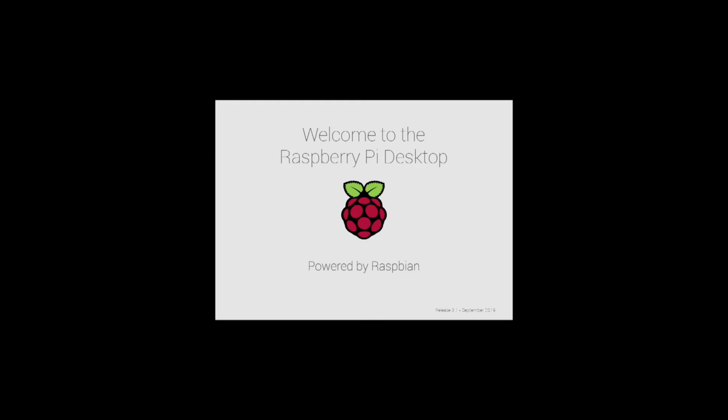Okay, so we're starting up our Raspberry Pi from the SD card now, and the first boot might take a while because it's supposed to do things like resize the file system. I don't know if it's doing it already, but it's going to initialize a bunch of stuff. The resizing is needed because the SD card image is around 4 gigabytes unzipped, but the SD card itself is 32 gigabytes, so it has a bunch of free space, and in order to make the operating system, the Raspbian, see this free space, the file system resize is supposed to be happening. So let's wait for it to boot.